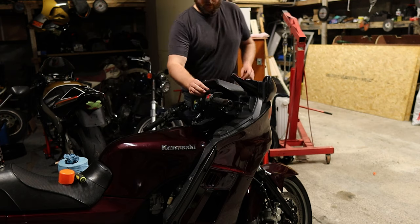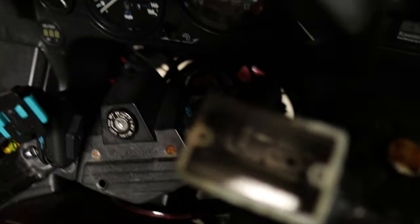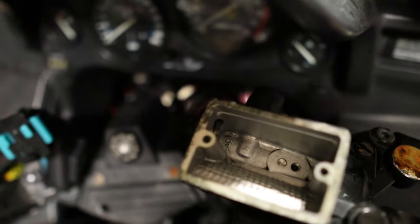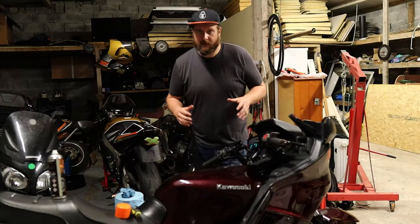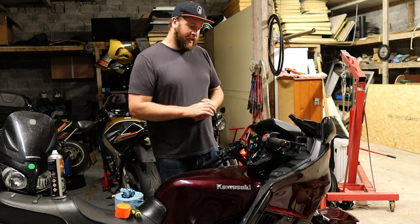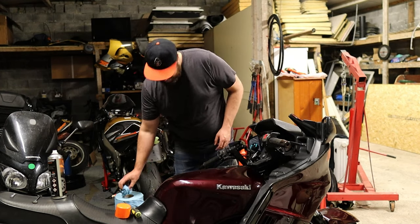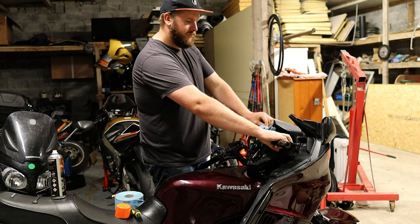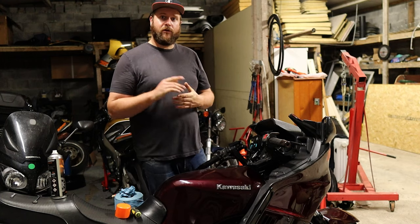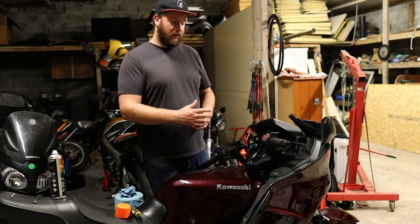I'm going to loosely put the bolts back on — hand tight — just to stop dirt going in. I'll show you the cleanliness level: I'll get a toothbrush later, but you want it that clean because dirt can make its way down into the lines you fit later. Next, we're going to bleed as much out of the actual brake lines as possible — just squeeze, squeeze, squeeze, crack that bolt at the bottom. I've done that before so I'm not going to rehash it. I want to show you taking off the lines and removing the caliper.